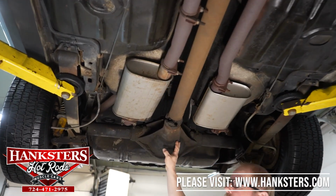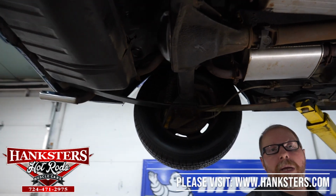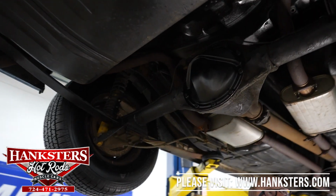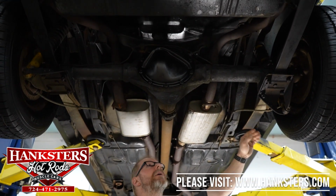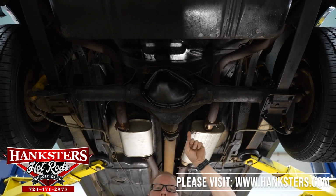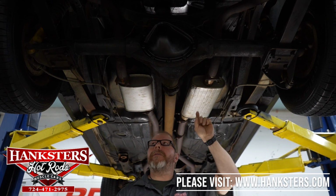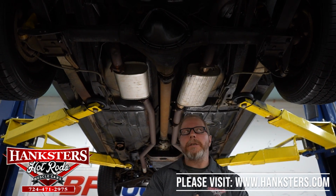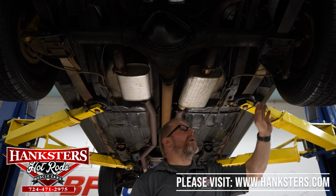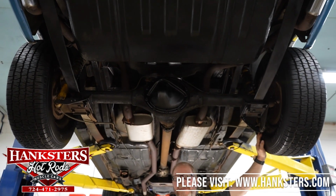As far as the rear end of the car goes now, the rear suspension is going to be a mono-leaf rear suspension. It does in fact have the coilover rear shocks as well. This is a GM 10-bolt rear. I believe the gearing in this was a 3.08 gear if I'm not mistaken, but we will have that information in the description for the car. As I mentioned before, it's power brakes, disc up front, but drums on the back.